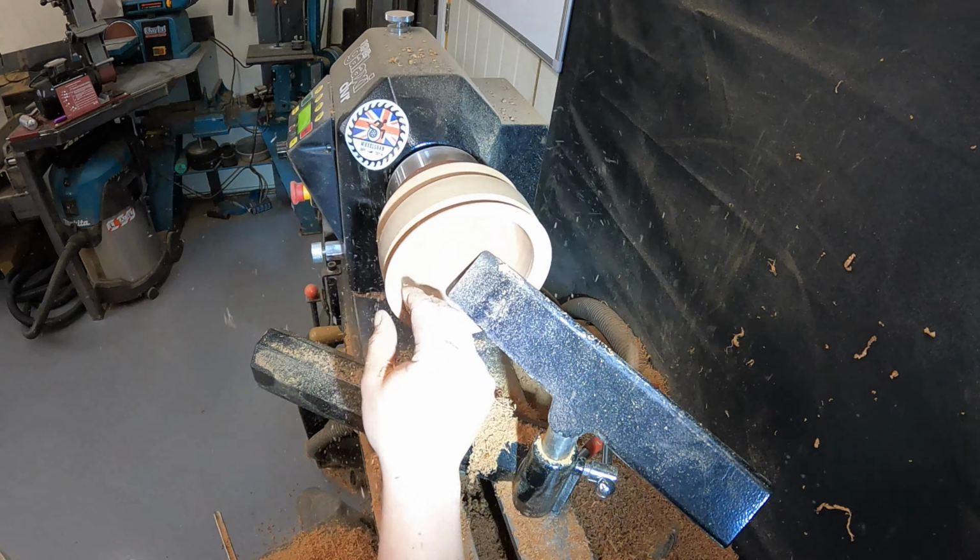Right, okay, so Yorkshire grit. Play on. Looking nice and smoothly, slowly. Okay, that's that done. Now, speed up at 800. I go over it with your rag, or your tissue, sorry. And the pressure just causes the Yorkshire grit to break down into really fine, powdery stuff. The aggregates inside it break down, so the sanding compound gets finer and finer and finer.